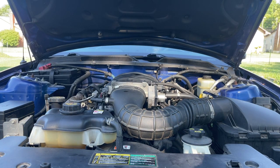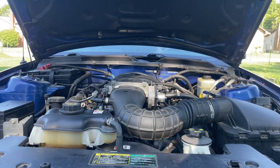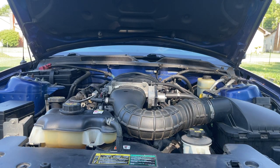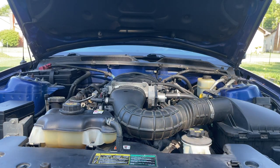One of the things I noticed right off the bat, when I looked at his controls, is that the blend door knob might need to be replaced because it's a little bit on the loose side. But when we hook the gauges up in a minute to get a preliminary reading for today, you're going to see that he's got hardly any pressure in here. So I think he might just need a charge. But let's see what we can get into today.